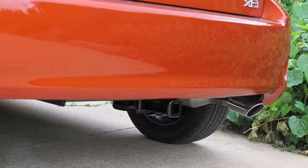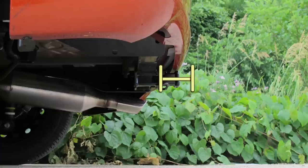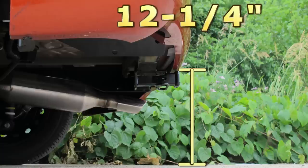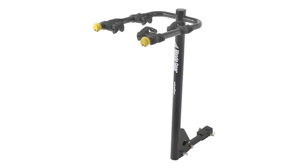This is what our hitch will look like once it's installed. Now we'll go ahead and give you a couple of measurements to assist you with selecting accessories for your new hitch. From the center of the hitch pin hole to the outermost edge of the bumper is 3 inches. From the top of the receiver tube to the ground is 12 and a quarter inches. This will assist you with selecting accessories such as a drawbar, a bike rack, or a cargo carrier.